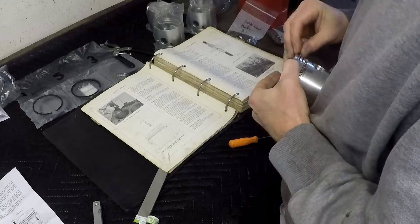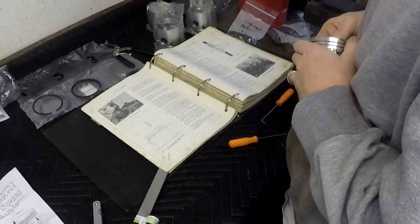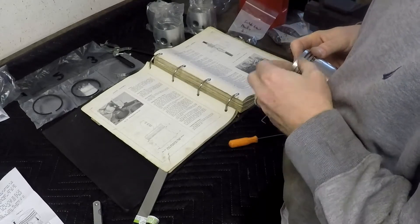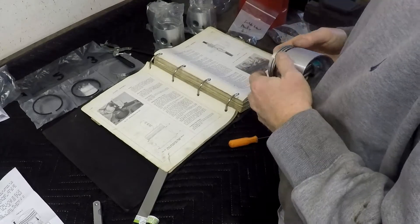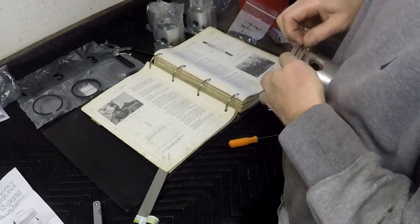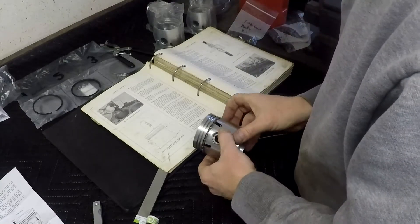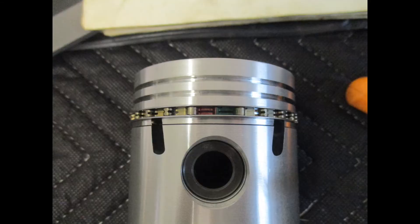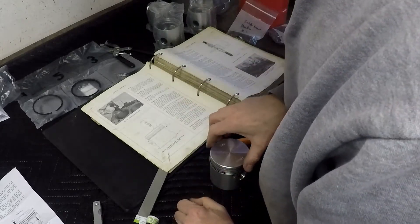They can be a little painful to install — I'm not wearing gloves again because it's easy to tear them. One important thing to note about the oil ring: depending on the manufacturer, it comes with instructions. This particular oil scraper ring had a red side and a green side, and you should not have any overlap where the ring splits. The upper and lower spring rings that hold it in — I offset those so their gaps were not in the same spot.